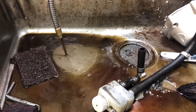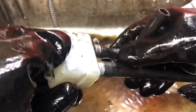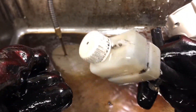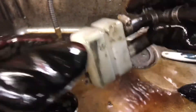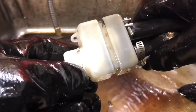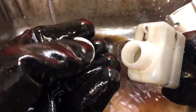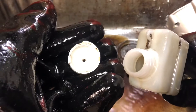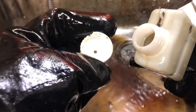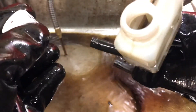You may ask how water can get in there — it certainly can't get there from the inside of the engine, so it has to come from entering into the reservoir. The cap is in terrible condition: it's all cracked, it's got a piece missing out of it. And taking it off — it doesn't even have the gasket or seal inside it. So that hole in the top of the lid was open to the atmosphere all the time, allowing any rainwater to go right inside and mix with the fluid.